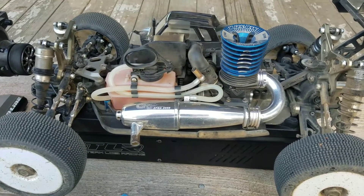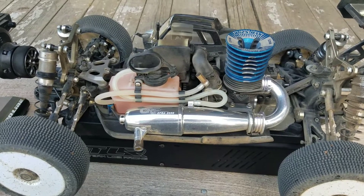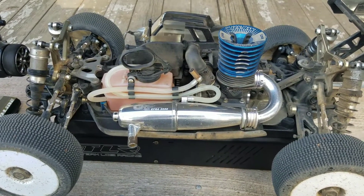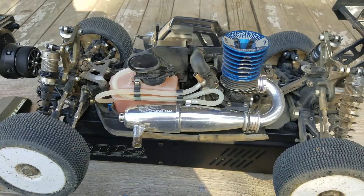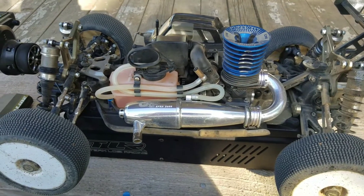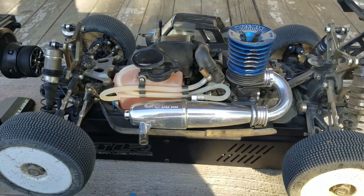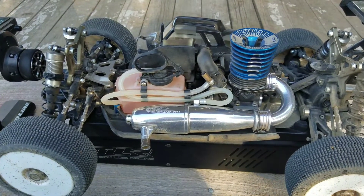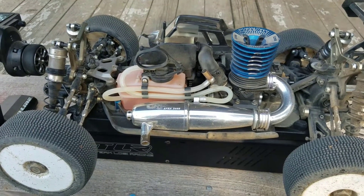Take notes on this stuff. If you're doing hour mains, this would probably be a good setup. If you're doing indoor qualifiers and five-minute races, the other way might be better — it was a lot more crispy on the bottom. Top end wasn't as good as it is now, but with a little more shim in there and a little less compression, the top end really came to life. This thing just sings really good.